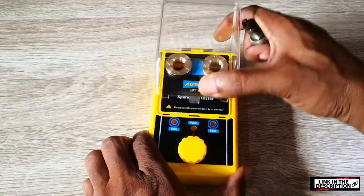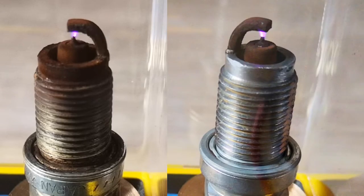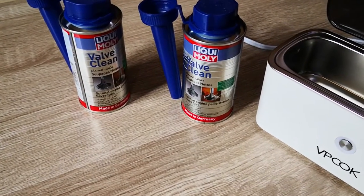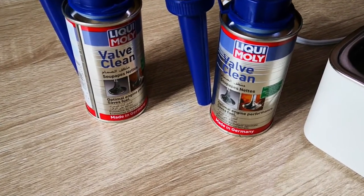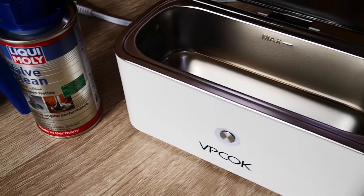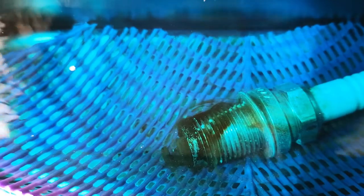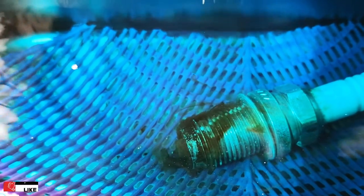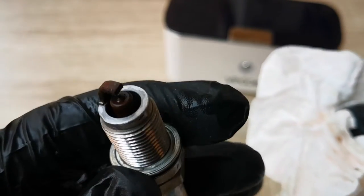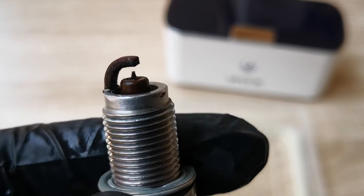Finally, to prove there was no damage to the electrodes, I did a before and after test of the spark plugs using this Autool device. The spark after the cleaning was in no way diminished. In the end, I learned a valuable lesson. I was really thinking the Liqui Moly would work since it usually dissolves carbon, but the basic truth was that the structure of the fluid did not give the best chance for generating the much-needed cavitation for cleaning — and as I said, it's not a recommended use by the manufacturer. I thought to show both the failure and success in my experience so you don't have to spend money trying liquids that don't work with ultrasonic cleaners. If you have any other suggestions on ultrasonic cleaning fluids for spark plugs, be sure to let me know in the comments. Hope this has been helpful, catch you on the next one.